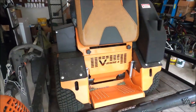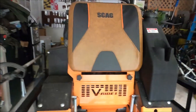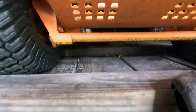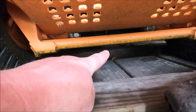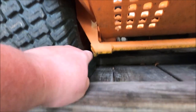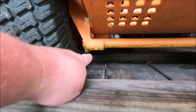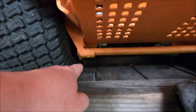One other thing I don't like about this machine is the oil changes. Doing the oil changes on this one is a little bit harder than the other one. The other V-Rides, if you come underneath, there's a clear tube that comes in the middle right here, so you can slide your drip pan underneath and drain the oil out of it. For this V-Ride, it's over here and it kind of bumps almost against this tire, so you really have to nudge your pan underneath and make sure you get it all the way under there. I do miss the old one because I never leaked oil — on the new one I tend to leak a little bit more because it drips down there.